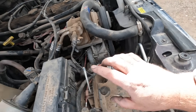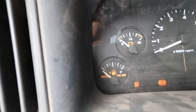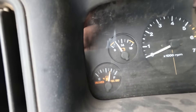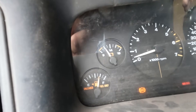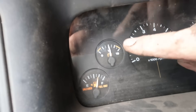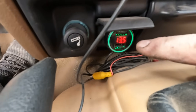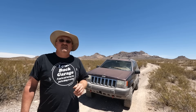So moment of truth — let's see what this thing does. Not running... running. That looks like something useful. I like that. 13 and a half — perfect. It's working great; I've actually been running it for a while with no problems charging and I've been enjoying the bountiful 13 and a half volts. So I'm going to keep driving around and enjoy this nice day. You guys keep having fun too — we'll see you next time.